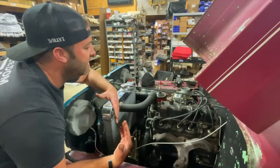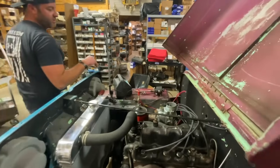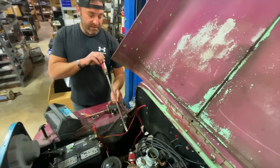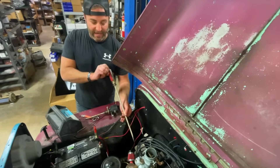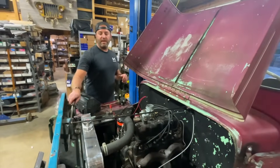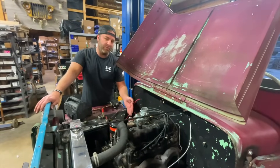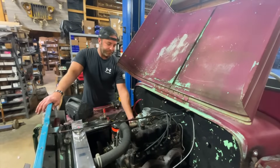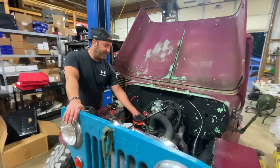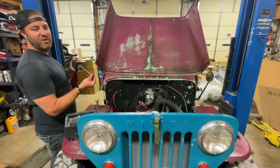With Joan on one side and me on the other, I took a long screwdriver and, with the distributor out, I got in there and turned that oil pump 180 degrees. Once I turned it 180 degrees, we needed to line it up so that number one would be at the five o'clock position. This offset only goes one way.